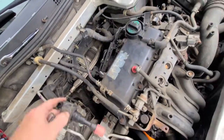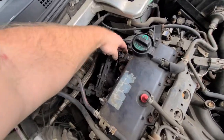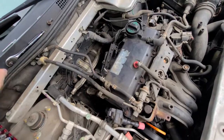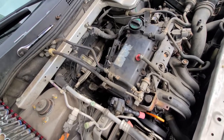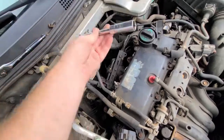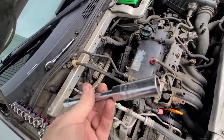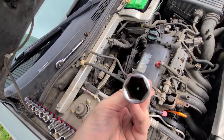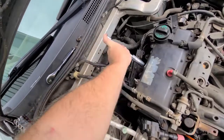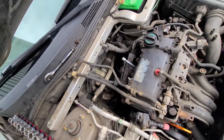There's your coil pack as it comes out. We'll hide those and then we're going to use a spark plug socket — this is a 16mm spark plug socket and it has a little rubber catch. We'll break the spark plugs loose and go ahead and take them out.